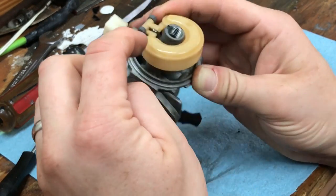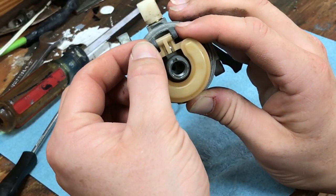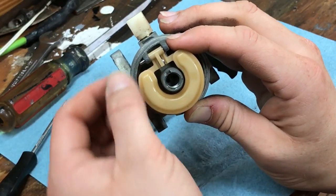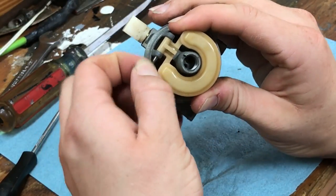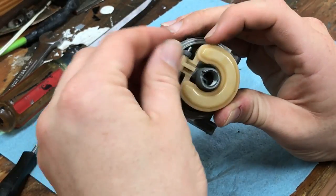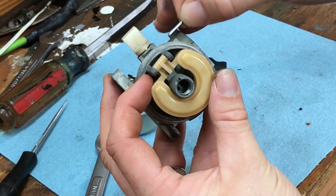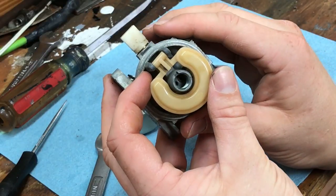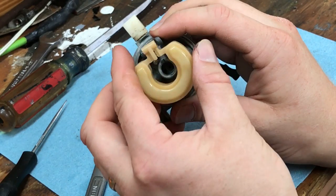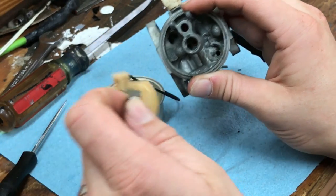At this hinge you'll see this little metal valve right here. Whenever you tap the pin out of the hinge on the float, be careful not to lose it. We're going to hold everything in place and just pull the pin out — sometimes you need a pair of needle nose pliers, and sometimes you can get it out with your fingers. Now with the pin out, pull the float outward like this, and the needle will usually come out of that little channel on the float.